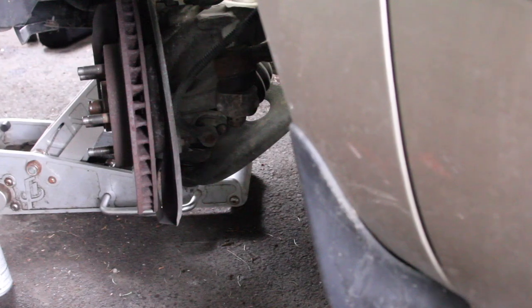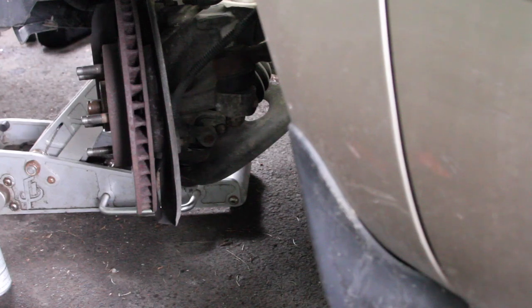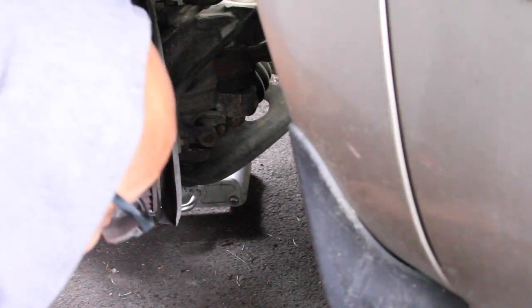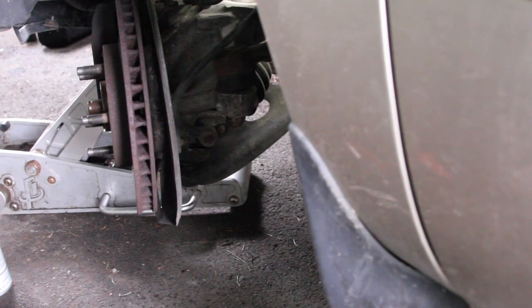Whatever. Okay, so there's going to be a cotter pin down here and a ball joint. Let's get some of my good pliers. Funny thing is the ball joint looks practically brand new, which should make this whole job easier. So I know that I'm not giving you the best view because you're actually getting the back of my head, but there's a cotter pin, bend it straight, you push it out. Pushed it out. And then, since it's new, I'm gonna put it back in the parts bin. If it wasn't new, I wouldn't be using it.